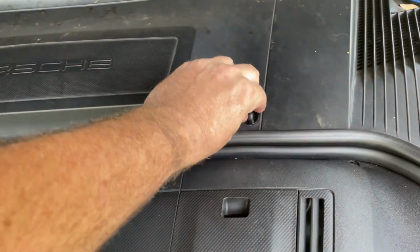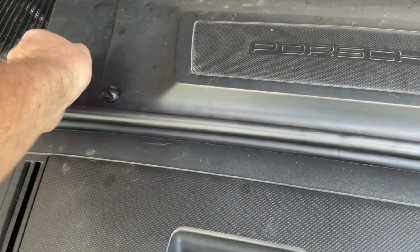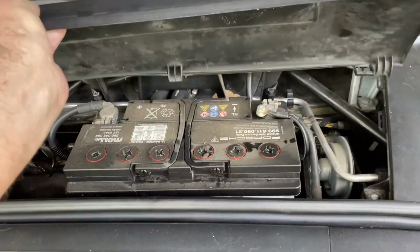I haven't even disconnected the battery yet from my car, so I've got to go do that before I actually take that positive terminal off. Otherwise, I could get fried or cause damage to the starter, to the engine, who knows what. Always definitely make sure you take the battery loose before you do anything like that.